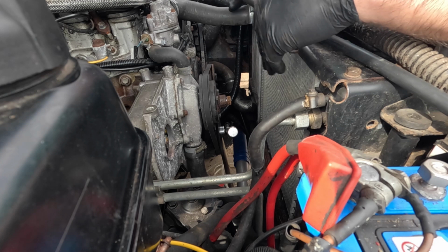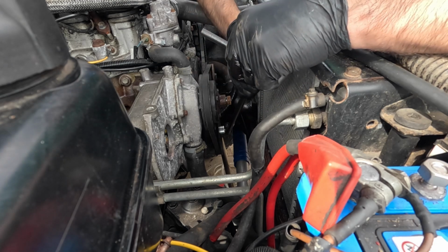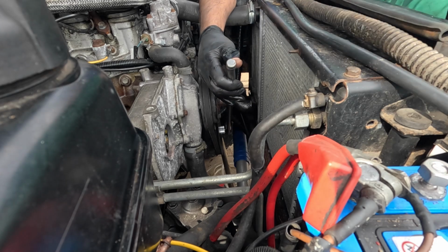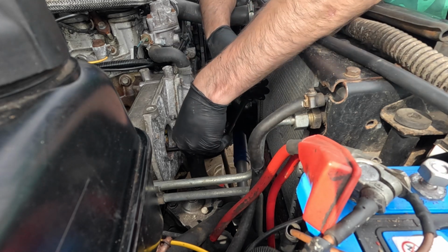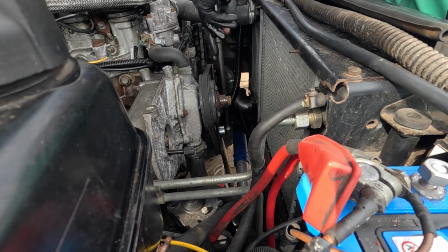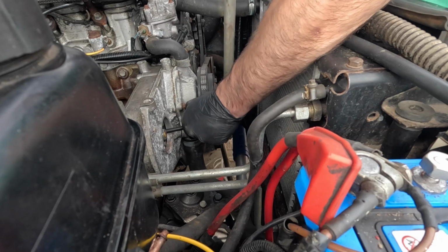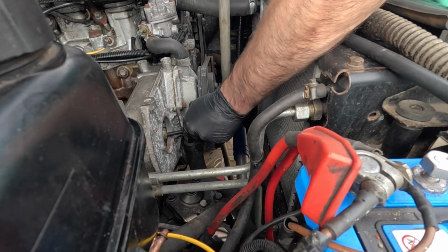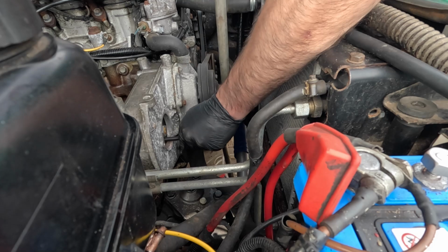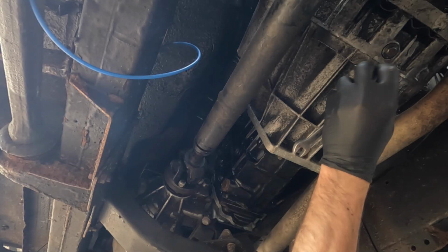I quickly removed the fan and the fan cowl, allowing me access, because it's been a 200 TDI. It's got a larger bolt on the end of the crankshaft than the 300. Oh, the cheater bar's a bit excessive, but that lets me get the ratchet on this. Makes life easier for cranking it. This one has actually still got the wading plug.